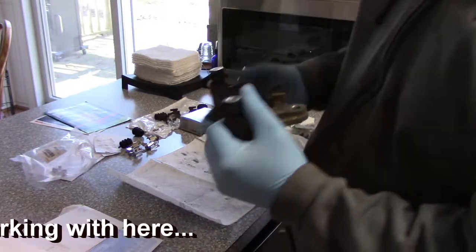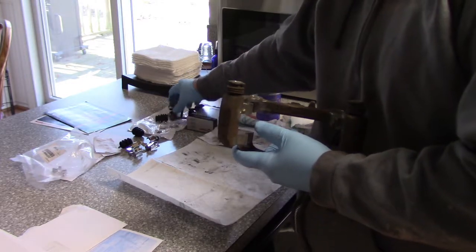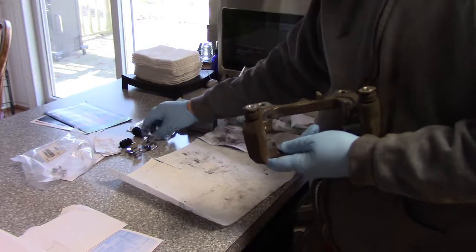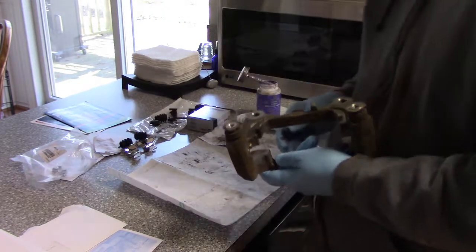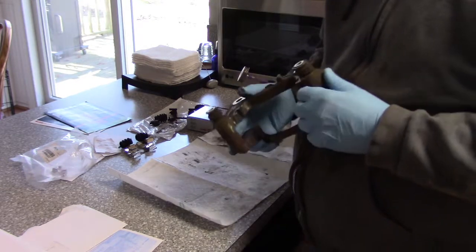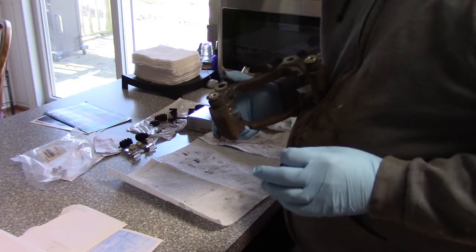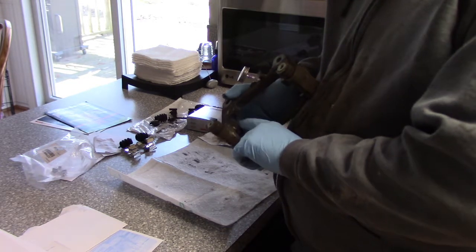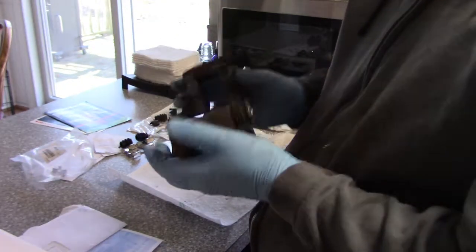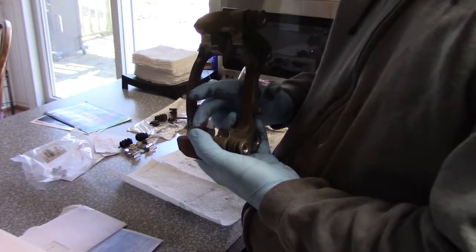So, I took the hardware out from in here, these pieces, and I wish I had a parts cleaner. That would be nice, but you don't want to inhale this dust. So I took those off. I have a nice little Dremel tool with a little rotary style grinding wheel, a little stainless steel thing, and I cleaned all these areas up. You can use a file or a wire brush, but I cleaned up all these areas where the hardware will reside.